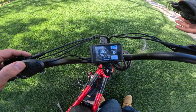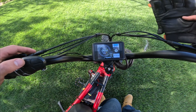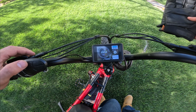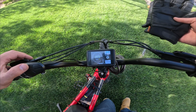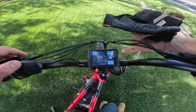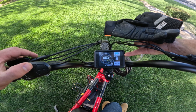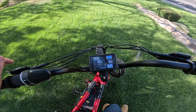It can be set to three, five, or nine power assist levels. We have it set to five, and this just increments what our top speed is and what our maximum amperage is, scaling linearly. We have a top speed of 50 miles an hour in mode five. Assist zero is essentially no assist, then 10, 20, 30, 40, 50 miles an hour with amperage scaling 20, 40, 60, 80, 100 amps respectively.